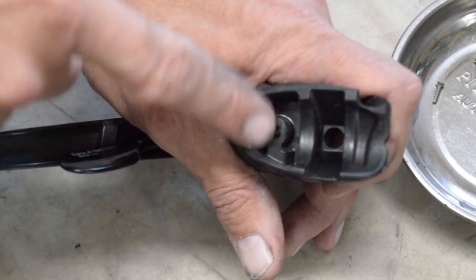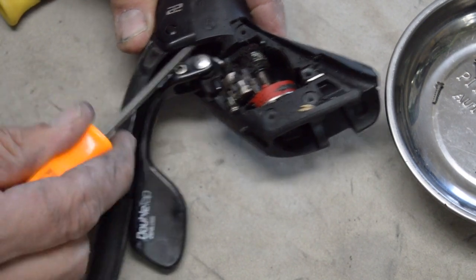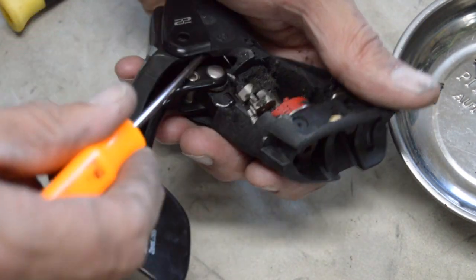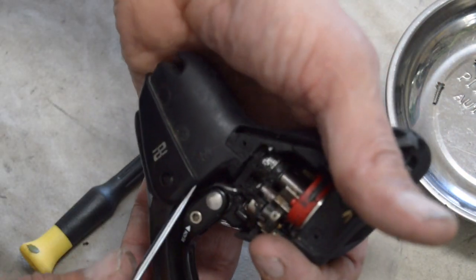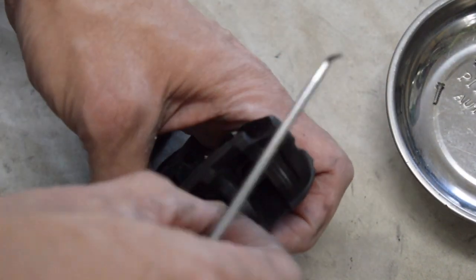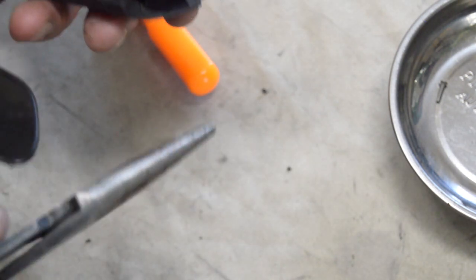Just back it out three or four turns, then you can push that pin out. I like to use one of these 90-degree picks, but in a pinch a long-handle three millimeter Allen wrench works — just something you can bend in there and push on the end of that pin. It takes a little time sometimes to find the end of it, but it's not too difficult. Once you can get it poked out enough, you can get needle nose pliers onto it.